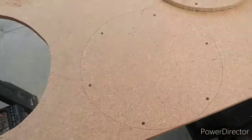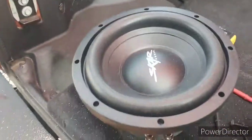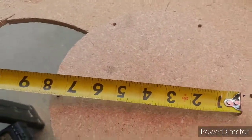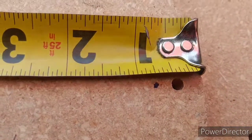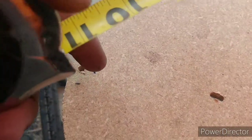There's my first one and my second one — I went ahead and drew my line around it so the second one is ready to go. I did my measurements on the Skar: from here to here is about seven and a quarter inches — that's where the actual lip of this speaker is going to sit. I measured seven and a quarter to see how close I can get. Found out that each one of these coming inside is only three-quarters of an inch, so your dot needs to be three-quarters inside. Go all the way around and put a dot three-quarters of the way in, then draw a circle. I'll stick my jigsaw through the hole already cut and cut all the way around until I hit that line — then the speaker should drop right down in there.